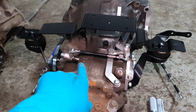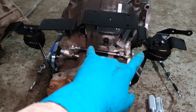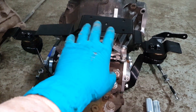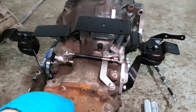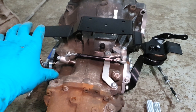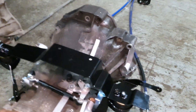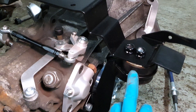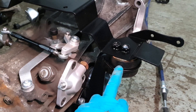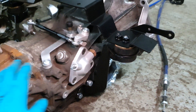This kit converts to the same spacing as the early car mounts. If you have an early car, it bolts straight up. If you have a late car, this piece here is supplied — it goes onto the standard factory late crossmember and you need to weld it into place, but then your car will be converted to early spec. Included with these mounts are rubber inserts, but poly bushes are also included with the kit so you can tune them to exactly how you like. There are also some other parts in the kit to allow you to adjust the stiffness of each of those.